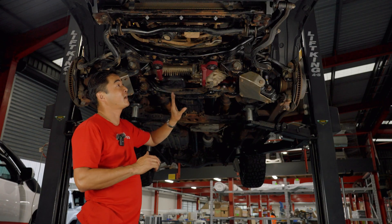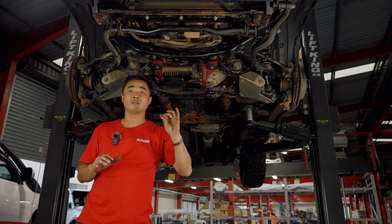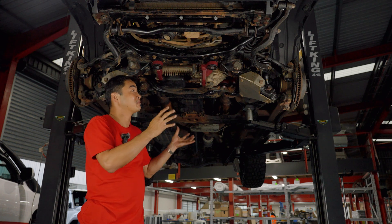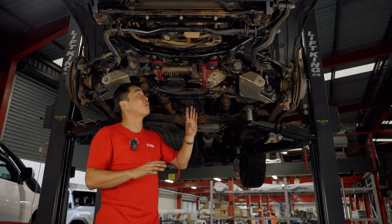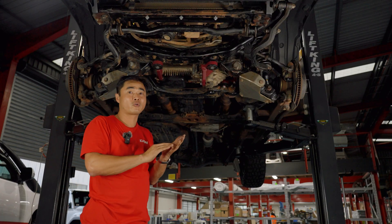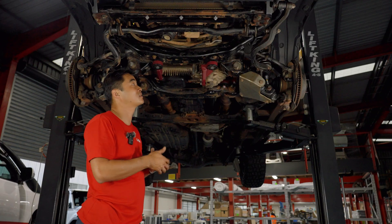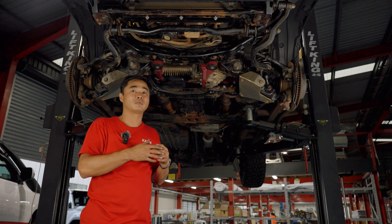Toyota at the factory does offer protection, but generally it's fairly light gauge thin steel, and if you do bend those they're a bit more of a pain to get back on and off. The traditional offerings for underbody protection have been strong but heavy steel — your 4mm steels and stainless steels — or your lighter but generally not as durable aluminium.